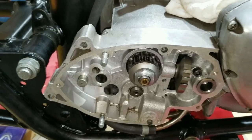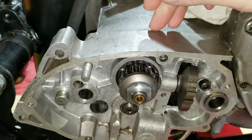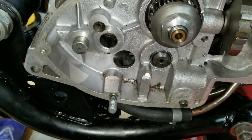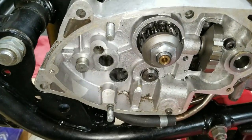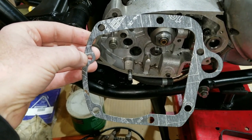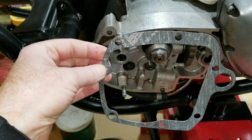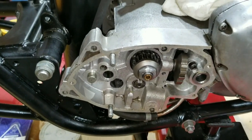The reason I'm not going to use a gasket is because a gasket actually creates a gap and we'll end up with more end play in our shafts. We already have some end play as-is. This particular gasket isn't the correct one anyway — it's for a five speed, about '75 or '76. It's kind of hard to find a '74 bike in general because Triumph was on lockout at the factory in '74, so barely any '74s were ever made, and there was low production in '75.